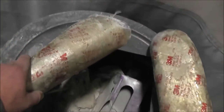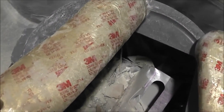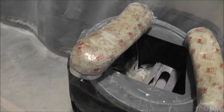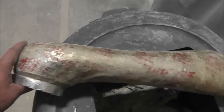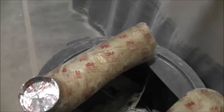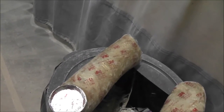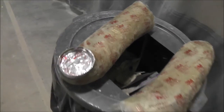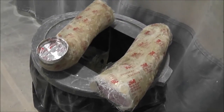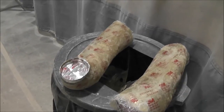When I'm done and got it as thick as I want, we'll just drill out and chip out the foam and the tape, and then we'll have our air intake inlets. The outside will be sanded and smoothed out with body filler, primed and painted. It's another way to do that other than using the Duratec primer.